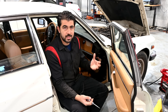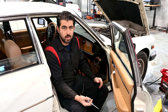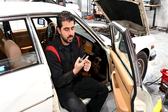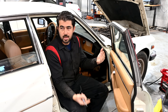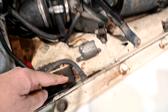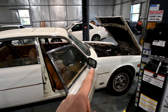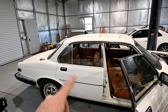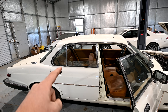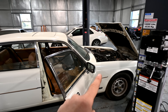You can have a short a couple of different ways: the motor for these power windows could have an internal short causing the fuse to blow; you could have a short in the wiring; or you could have a power wire with 12 volts shorting to a grounded wire, which would blow the fuse. Also, on most cars the chassis is grounded — the negative side of your battery is connected via a thick cable bolted into the metal chassis — so a manufacturer can run just one power wire to a component in the back of the car and ground it to the chassis, without needing to run a separate ground wire.